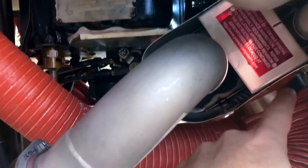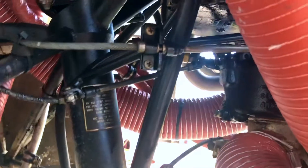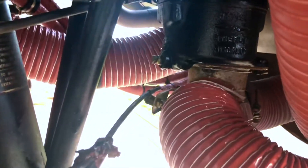If water were to come in, it can go down here and there'll be a place to drain. From here it goes to the carburetor heat flapper valve assembly, which is right there. The original aircraft's intake hose — or at least the one that came on this airplane — is still there.